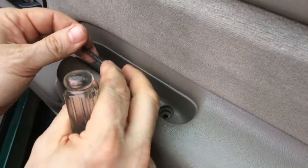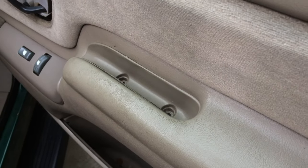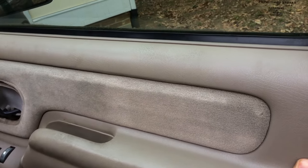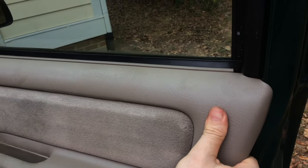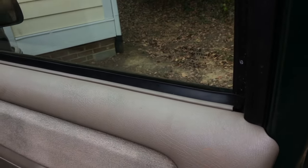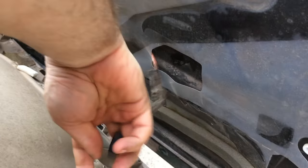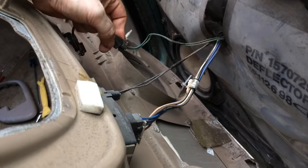After you get the Phillips screws out of here, unless you've missed one of these retainers, this guy should just lift off. Just be careful with it when you do it because there's some cables attached in the back. Usually what will happen is this little courtesy light might pop out of here. It looks like it pulled the bulb out and left it inside there. And then we've got a couple of speaker connections over here that we can pop loose so that we can get this out of our way.